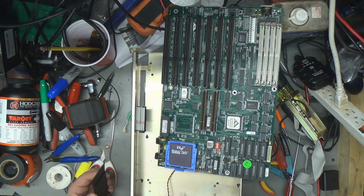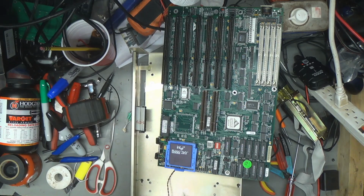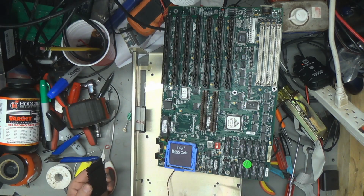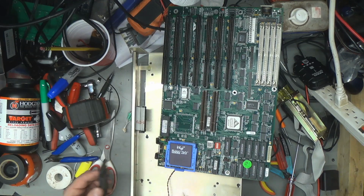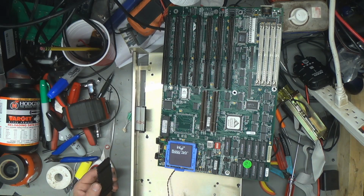So I've got a DX250 industrial board that would fit in up there. Delete the motherboard entirely. Drill a couple more standoffs into that power supply enclosure to hold the bottom part of that back plane, and I could junk this whole board if I can't fix it. I don't even know if I want to try to fix it. I mean, if this is a regular AT size motherboard, I could probably put some kind of early Pentium in here, which might be cool too.